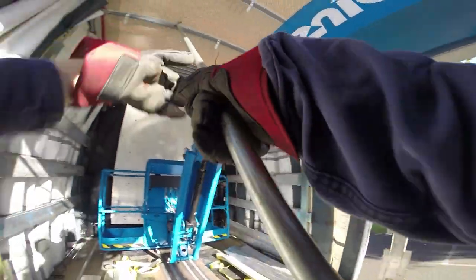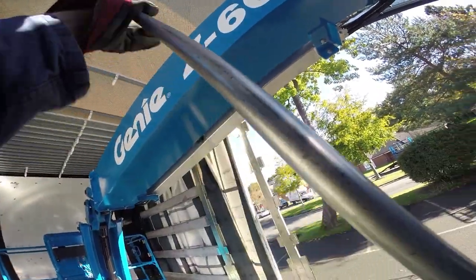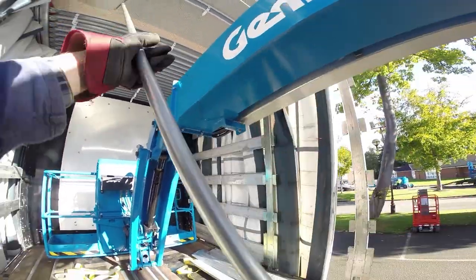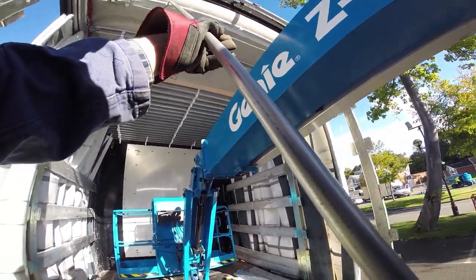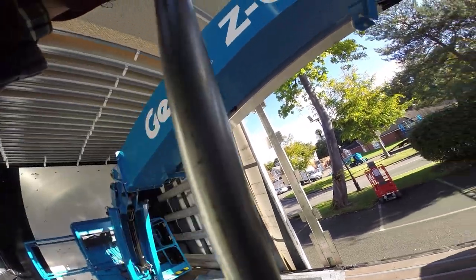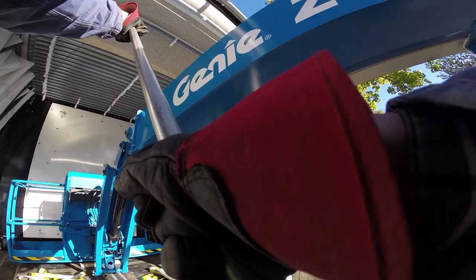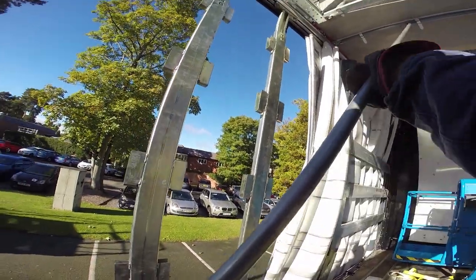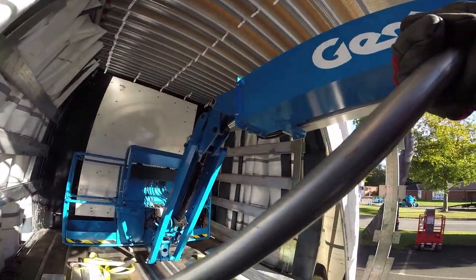The roof wants to go back again because the trailer is a little bit on a hill, so I could actually better just pull the roof. That's also possible. Not every trailer has this. I know the Chereau trailers don't have it, but this Pacton has a safety clip where the roof can fall in the front, and that's really good. If you have a Chereau, it's always the problem that it runs back again.